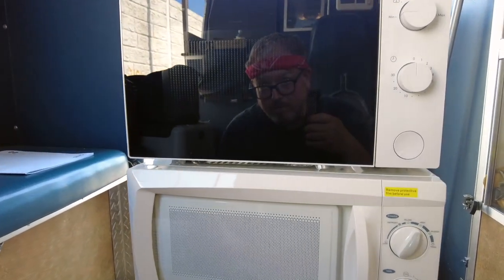Obviously the biggest question is how well do they work? One thing to know right off the bat is that they're actually not the same wattage. The Commercial Chef on the bottom is 600 watts. Low wattage is good for a van — you don't want a high draw. Yes, it'll take longer to cook your food, but it's going to be much gentler on your batteries, and you may be able to get away with less expensive batteries and a less expensive inverter. The IKEA is 700 watts. A 700 watt microwave should technically work on a 1000 watt inverter, but mine's modified sine, so it may not work.